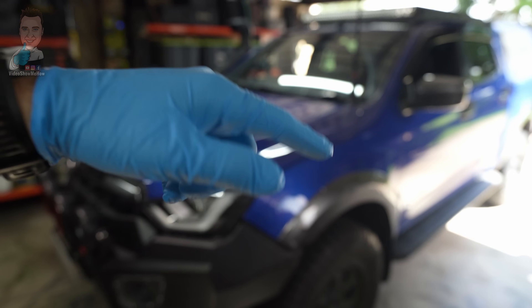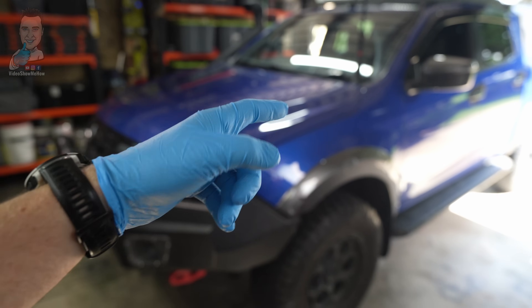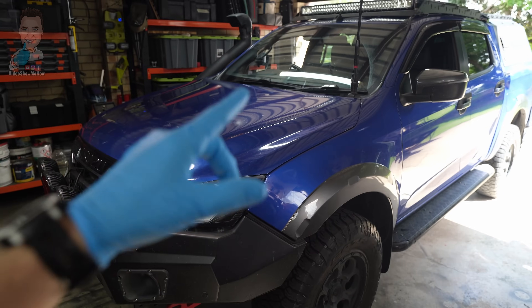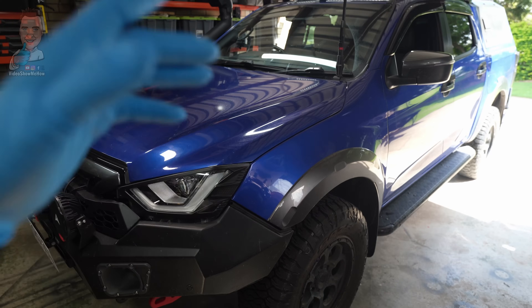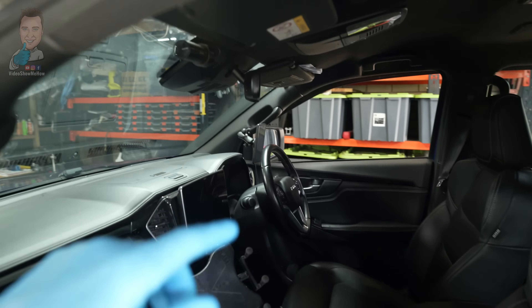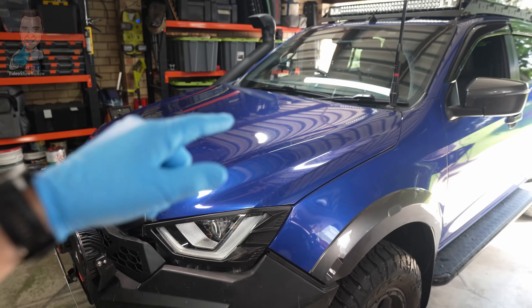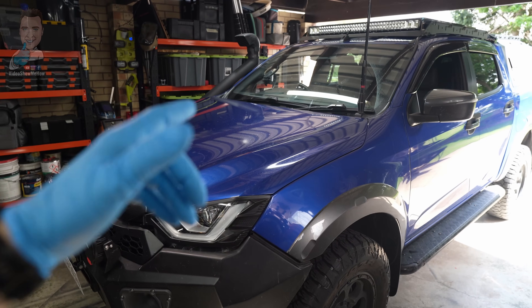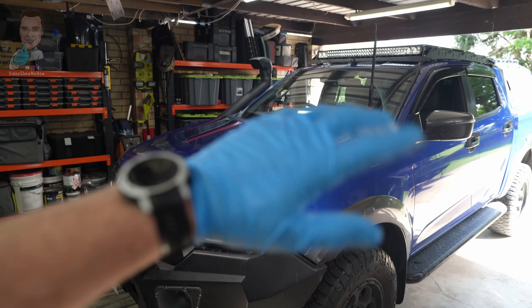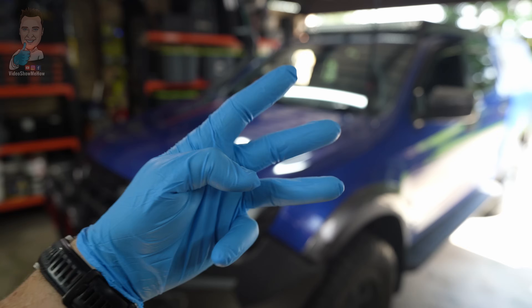Three: because you're more frequently in that locked-up state, you're not slipping and dropping between gears all the time on the freeway, which reduces the heat coming through your torque converter. The more these torque converters slip — particularly under heavy load, like towing — you'll see the temps absolutely skyrocket when you're in that unlocked and slip state. I'll put the link to a monitoring app in the video. So keeping the thing locked longer will ultimately reduce your temps. And when you're at full load, particularly towing, those three benefits only accelerate.